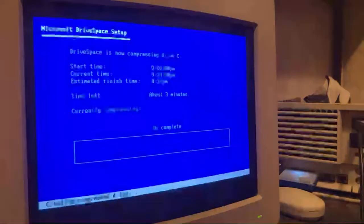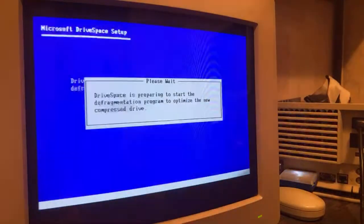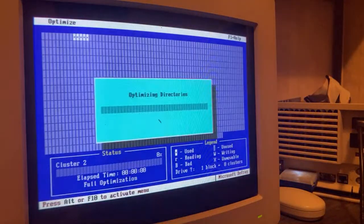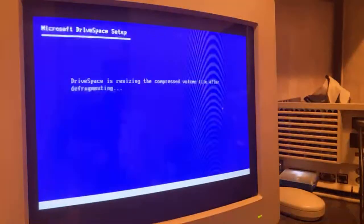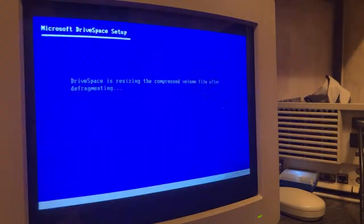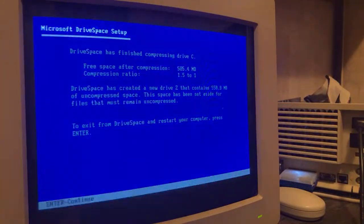I will say one of the things I do miss. I'm not going to leave it turned on. I do think though that with this Macintosh there is an issue with the memory or cache or something, and I need to find either a hardware test disk or some third-party diagnostics to run on it, because the machine has been freezing to the point where, doing certain things, it's completely unresponsive.